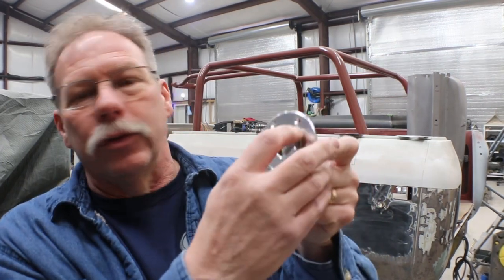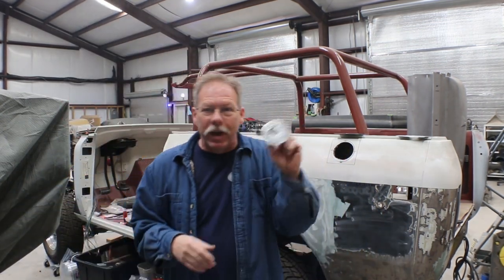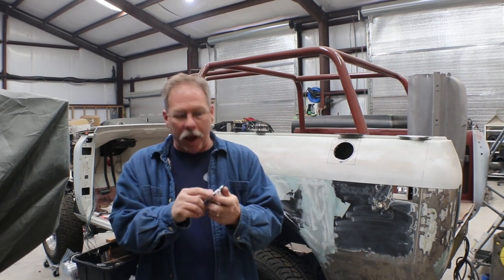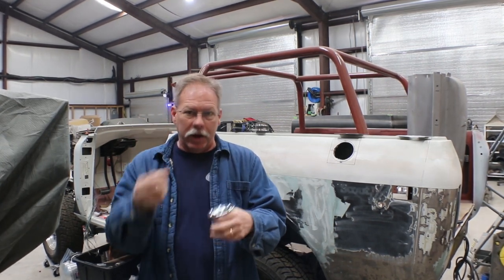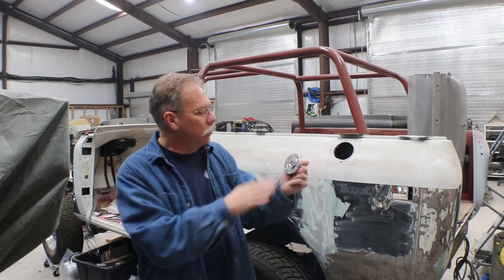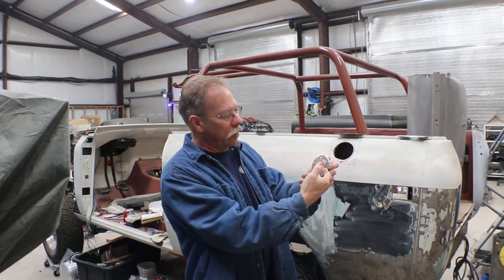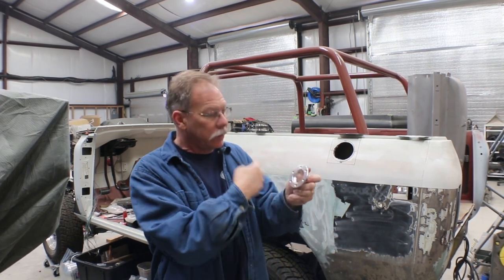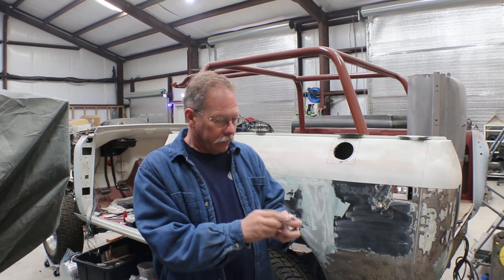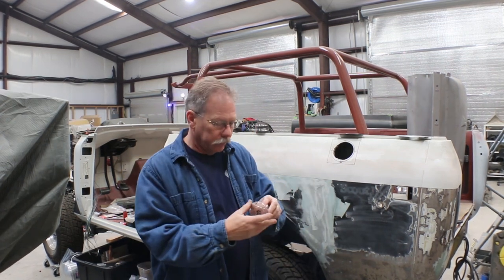The thing about it, you have this little flip lever, and then you turn it a little bit, and then the cap pops out. And to me, it's a very aviation-inspired design. This is the way when you're fueling aircraft over the wing, this is the type of cap that's on there. You flip up the lever, you turn it part way, the cap comes out, you fill it. Most of them have a chain on it so you can't lose the fuel cap. And whenever you put it in, you always make sure that the flap is facing the direction of the wind, essentially, so that in theory wind couldn't come up from behind it and pop it open and they lose their cap, because then you would also have a siphon effect and it would siphon the fuel out of it. And that stuff does happen on aircraft that get fueled over the wing, which is really not a whole lot of the commercial aircraft anymore. Anyway, beside the point story.